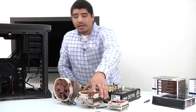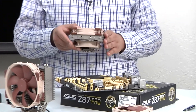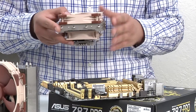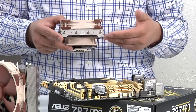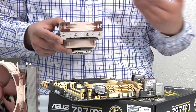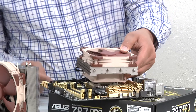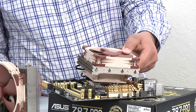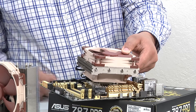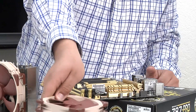If we go to a higher performing solution, the NHL12 is still going to be a great option. It gives us downward firing airflow and quite a bit more mass and airflow to deal with when pursuing higher overclocks. You can see if I press it down though, it is going to rest a little bit over that first DIMM bank. We still have generally enough clearance to work with larger modules, but that's a consideration point to keep in mind.